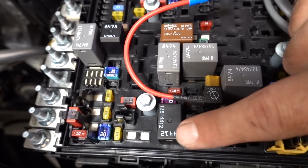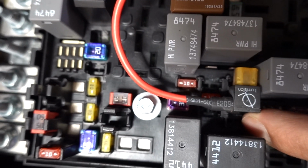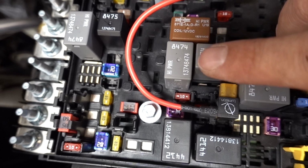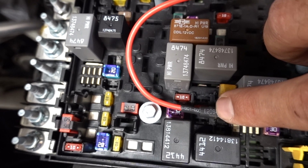You see these 2 relays here. It is the one that's right above here. If you don't have air suspension, I don't think there's anything in this particular spot. And one thing is, this fuse tap did not come with our Switch Pros kit. They do give you fuse taps, but they're not the ones that fit the new Rams. These are, I think, an ATC Mini Fuse 2.